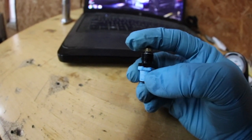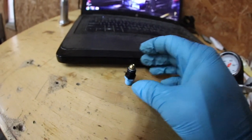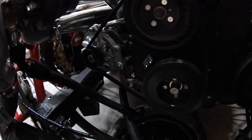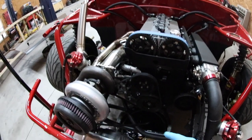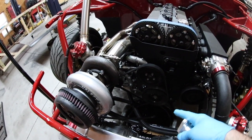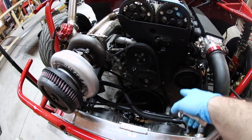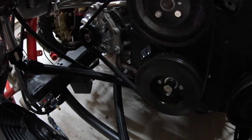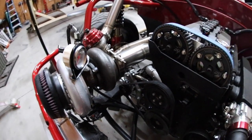I'm gonna pull the thread tape out of the oil filter housing like I talked about before, thread this one in nice and tight, hook the feed line up, and then put the gauge on top of the turbo — fire it up and see what kind of pressure we have. Okay, new fitting is in and it's tight. Because the fitting points straight down, it's gonna be a bit frustrating to put your nitrous jet in because it's gonna want to drop out of the bottom. So I moved the oil pan before going any further. I set the jet up in there, ran the fitting right below it so I couldn't drop it. So we're all buttoned back up — the restrictor is up in there, nice and tight, and up here on top we've got our gauge. Let's fire it up and see what kind of pressures we have.